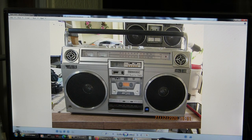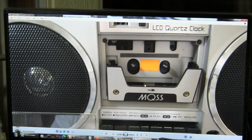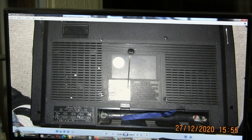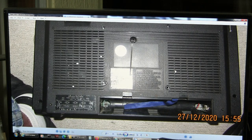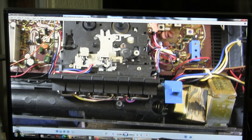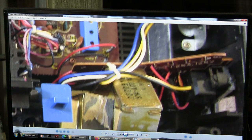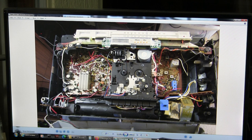Then there's the front again because I couldn't remember if I took a picture of it. To take this thing apart, you're going to take off the two screws there for the door because the whole thing comes through the front panel. There it is without it. These are the screws that came out — one over here and one there. Three screws total. I ended up putting two screws back because this one wouldn't attach to anything. Here's the inside of it. The transformer was out of its case, which was off of the circuit board, and was not lined up with the hole.